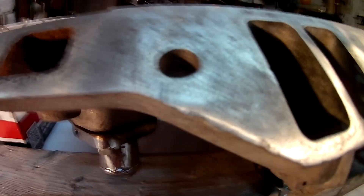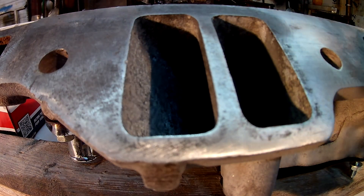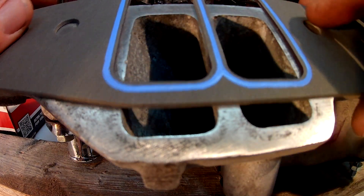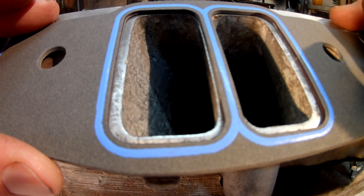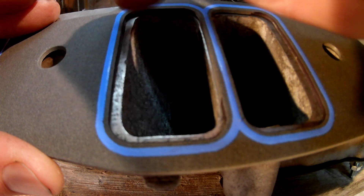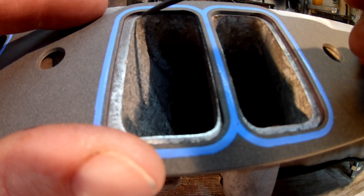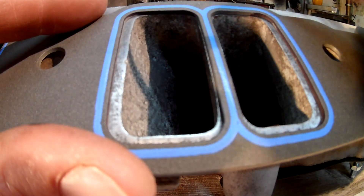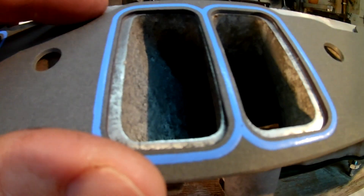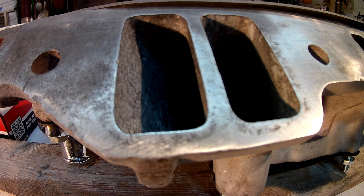Here's what I'm going with — this is a single plane old school Torker. That number is 2753, I think they call it the Torker 340, so it would have worked fine on a 340 and it will here too. Basically what we're doing is just a gasket match. I'm going to go in about three-quarters to an inch and just transition everything. You can see the overhang from that gasket.